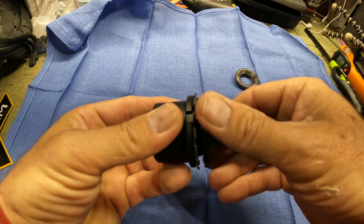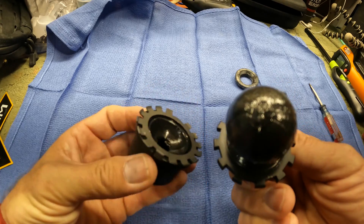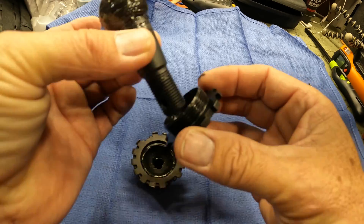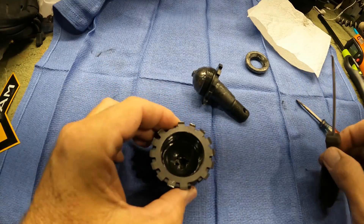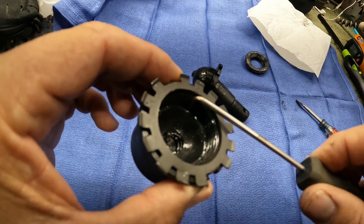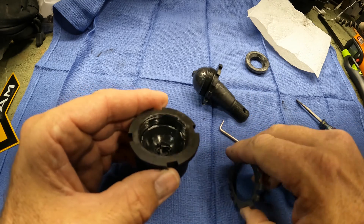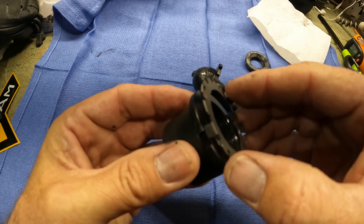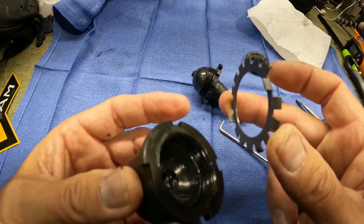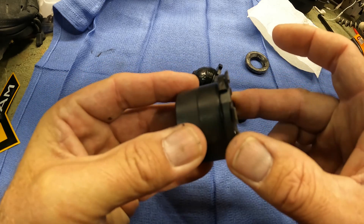We're going to unscrew the stud. There's the stud, the ball end, and what they call the threaded cap. Now this lock ring — pay attention to how it goes on, or lock washer. They already have tabs bent one way. See how there's two tabs that bend down? Those always go onto the body like that.